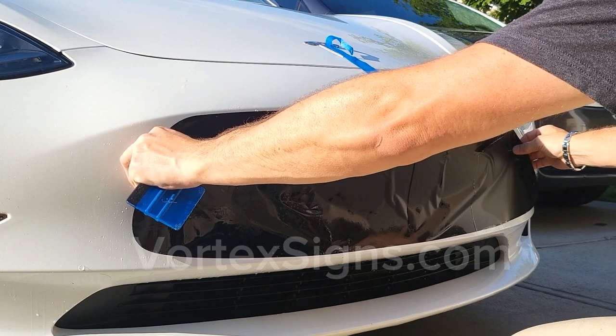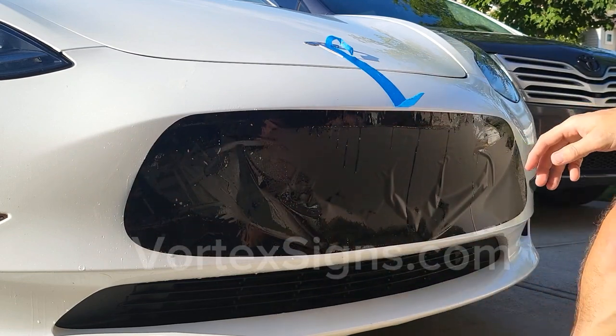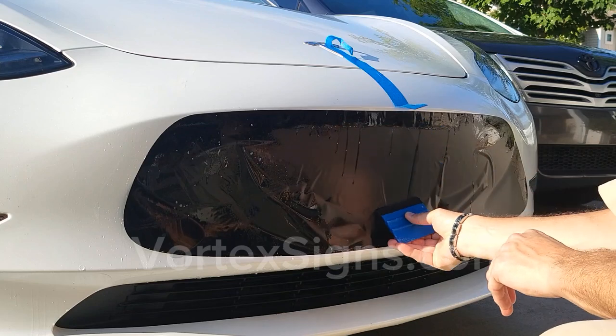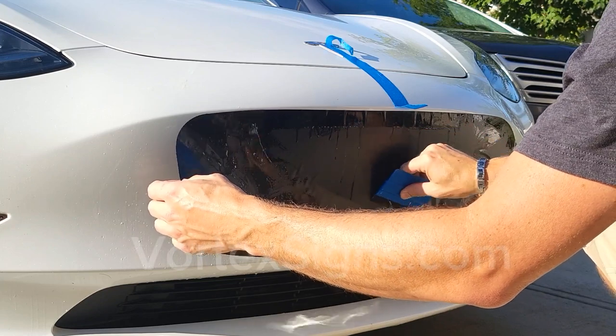Sometimes that one spot where you are holding the decal may not stick, so be careful. Find the true center on the decal and on the bumper and align it to the curve of the bumper. Slip solution lets you glide it into position. Use hood logo as a center mark.